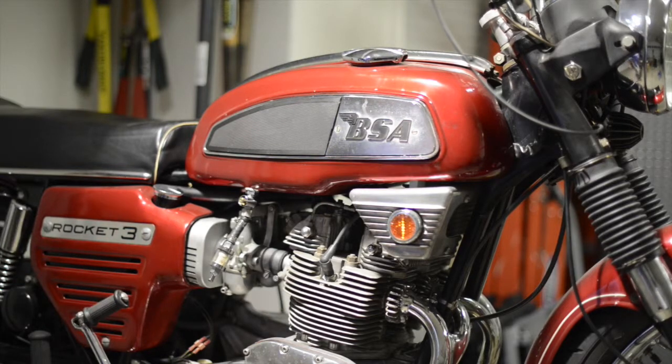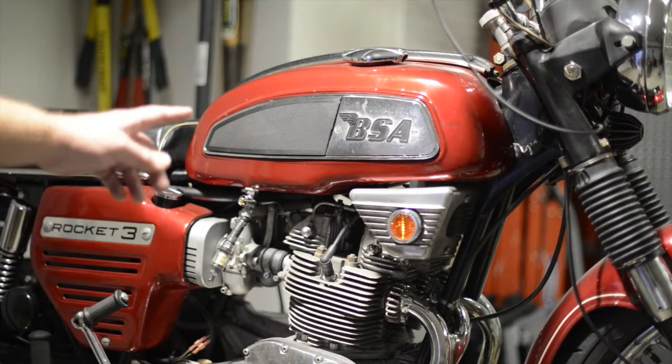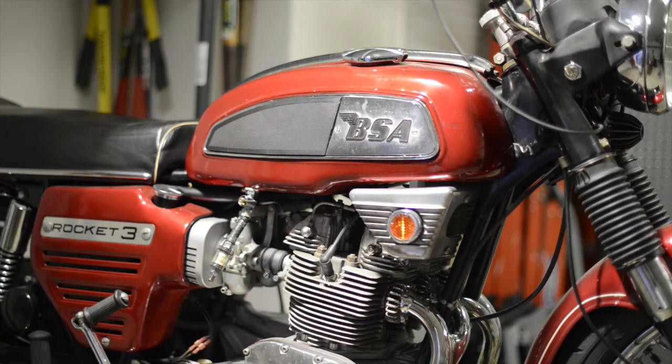What I'm going to do is start some diagnosis before condemning the engine. I'm going to pop off the primary side, take a look at the clutch and all the bearings in there, because the starter does go through the clutch. I'll take the primary drive apart, take the clutch off, and then see if I can rotate the crankshaft. At that point I'll decide if I'm going to start tearing it down from the top down.